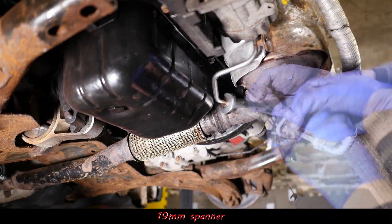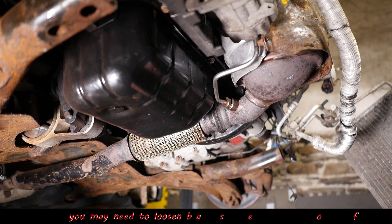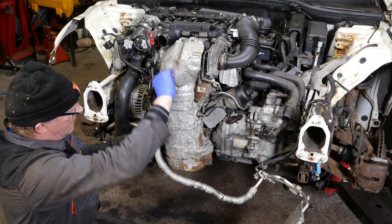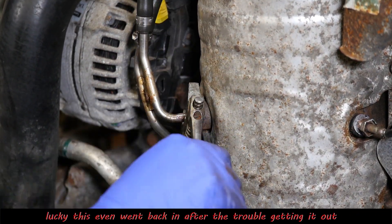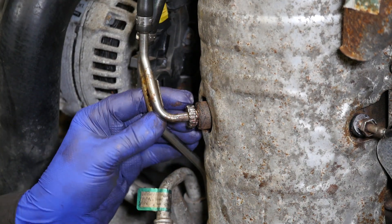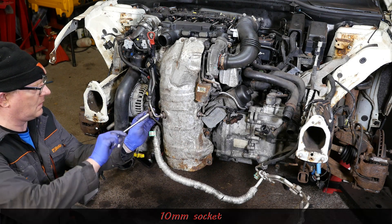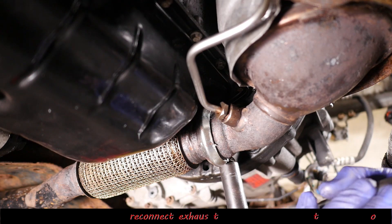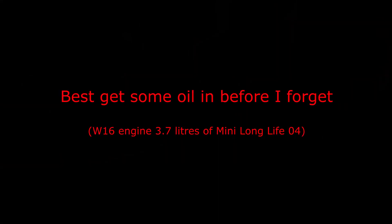I've sped this up because I had a lot of trouble getting that lower pipe in there - it was actually starting to cross-thread as well, so it was a bit of a disaster. But eventually I managed to get it in there. This nut is an absolute mess - very sharp, don't want to be touching that. I can then put the clamp back on with a 10 millimeter socket, and then finally the connection between the DPF and the exhaust pipe under the car.